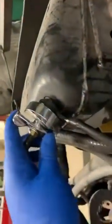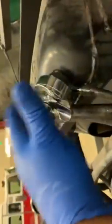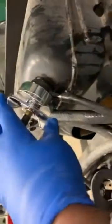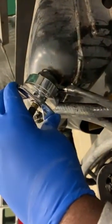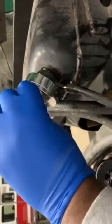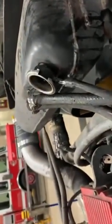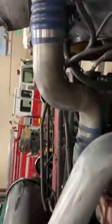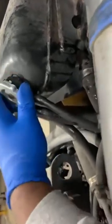From this point, I want to slowly release pressure. I don't want to just yank this off because if I do, I'll have coolant that comes splashing out — as you can see, somebody already did that and splashed coolant everywhere. So I slowly release the pressure, put it back up on the raised position, take it off, and then immediately put my cap back on. That way I make sure I keep the coolant system sealed up.